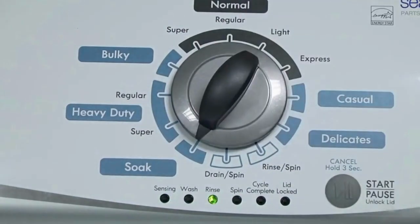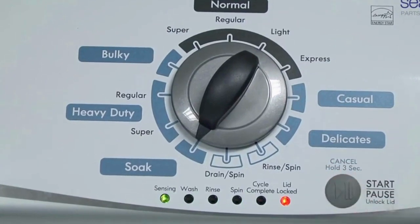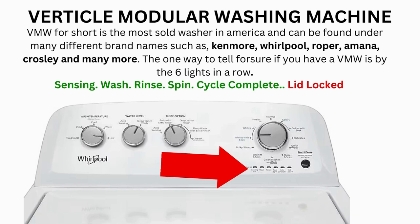When you're on the correct setting, the rinse light turns on — then simply press start. It begins the calibration cycle, which runs for 2-3 minutes as it checks all the cycles and functions on your machine. When the calibration cycle ends, if all goes well, the lid unlocks and the washer shuts off. Now try your washer to see if that solved your issue; if not, continue to the error code video.